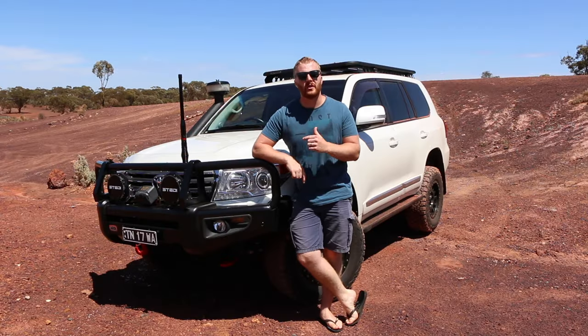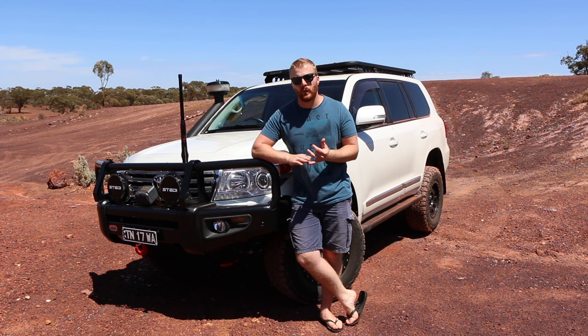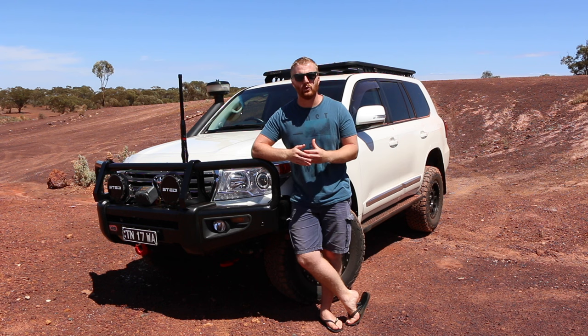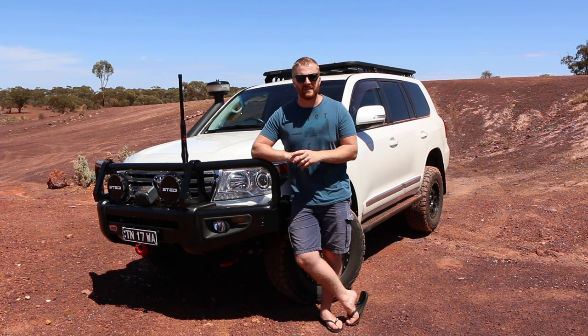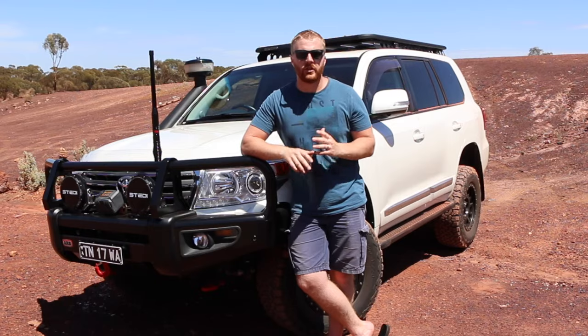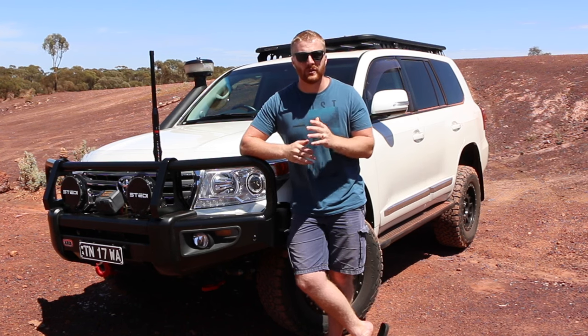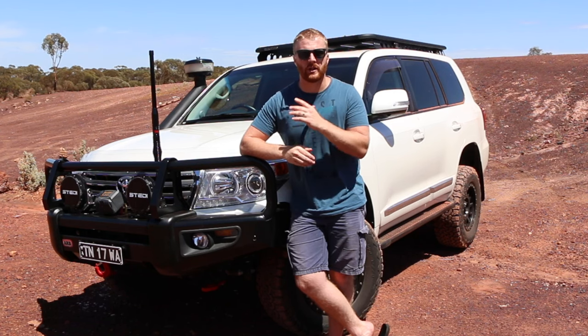One of my favorite systems on this car is what Toyota call crawl control. It's a system that you activate in low range, and it takes measurements from both the wheel speed sensors and also the G sensor — your gravitational force sensor within the car. It then calculates and alters brake pressure and engine output, sending power to the wheels with the most traction, which is exactly the opposite of what an unlocked diff would do. This allows you to crawl up, through, and over things at a really slow speed with maximum traction. The times you're going to want to use crawl control is a scenario like the one at the start of this video, where the wheels were spinning freely in an unlocked situation trying to go up a rutted-out hill.